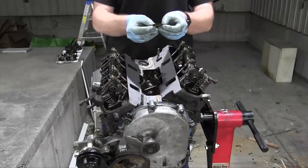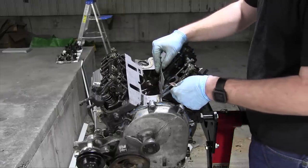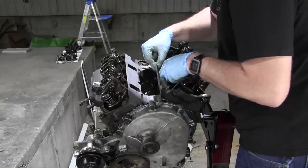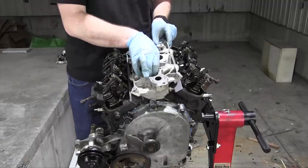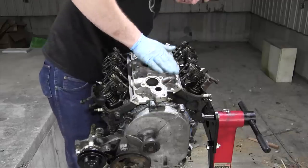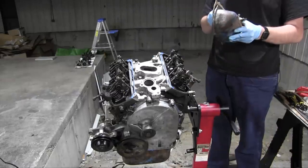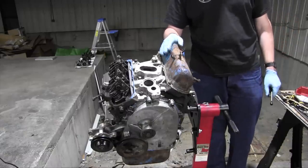There are these two little brass flanges that go under the intake manifold. The manual makes nary a mention of them. But they came out of both of these engines, and there's a locating hole on the gasket itself. So I'm putting them back. The cork gasket doesn't fit very well in there, but you know what, it's good. You'll notice I didn't paint the valve covers. You'll get over it.